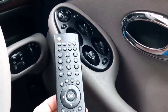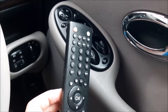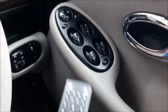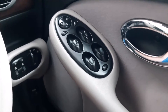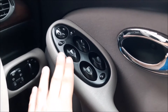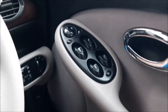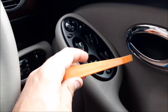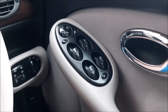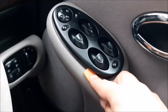It seems like that's how they built this whole switch. So what we're going to do is take it to bits, give it a clean — you can do this with your remote control as well. You split them apart and with something like isopropyl alcohol, clean the circuit board and the rubber buttons, and it normally does help them to work. To remove it, we'll gently prise it out using plastic trim tools and slowly lever it around.